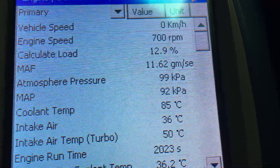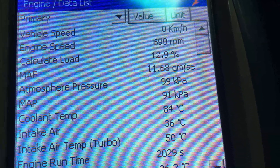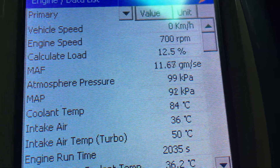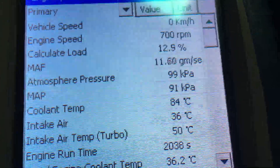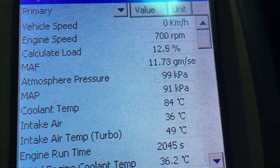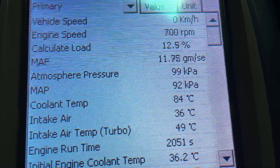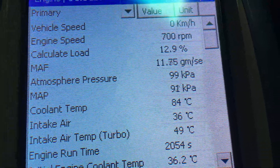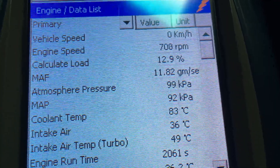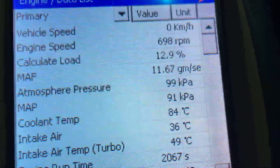For the 150 Prado — most are five-speed autos. You'll quite often see 14.9, 15.2 — if you've done 200,000 km your injectors are not okay but you'll probably still see that reading because it's a different system you can't rely on diagnostics. You might see 12.9 or 13.7, that's fine too. Even 16-point-something is okay in a 150 Prado. Once you start seeing over 17 or 18, you've probably got a problem — even 18 or 19 and you've got a pretty big problem. That's a massive difference between the two systems.